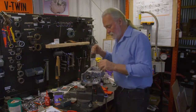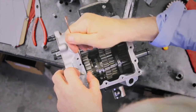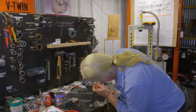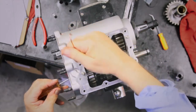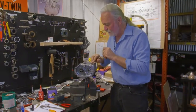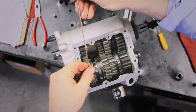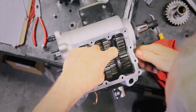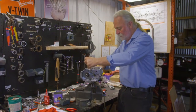You're going to install it on the right side here. Be ready with your hook device to catch it. You can kind of observe it here. And then work your way through. Again, we'll hook it again and kind of lift it and turn it. This can be quite testy. Okay, so we're lifting at the bottom, at the same time applying pressure to the shaft with my right hand. I'll rotate the assembly semi, and I'm able to luckily work my way in with the shaft.